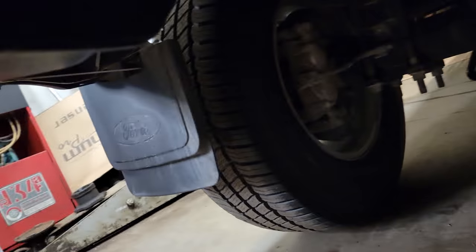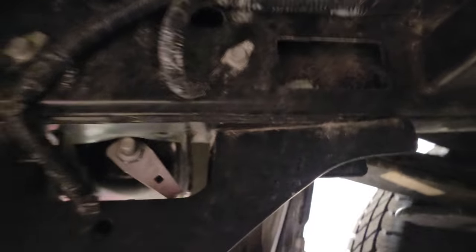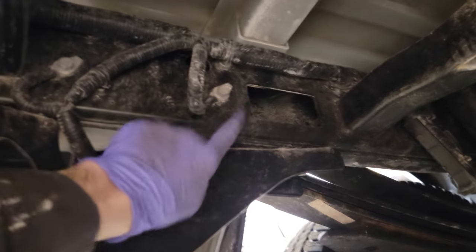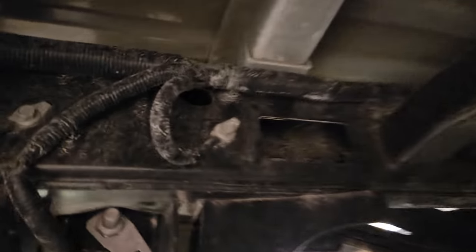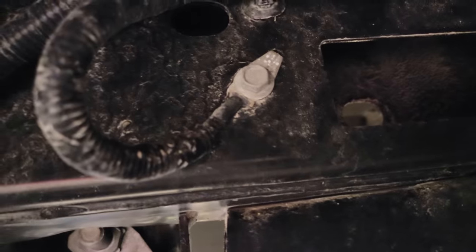The spare tire is down. If you haven't watched the video on how to remove the spare tire, I'll link that in the description. This is the ground bolt that you are going to be using right here - that's what we're going to be loosening and putting our eyelet from the harness onto. Now we're gonna come back up to the top of the truck.